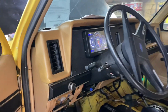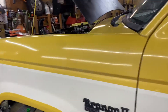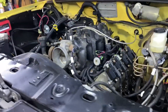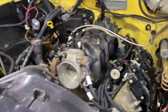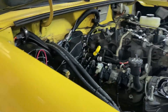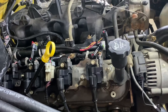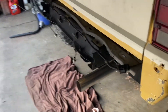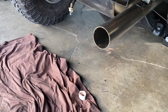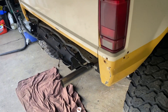She is now fully warmed up at idle and sounds nice and smooth. Got the heat — it is blasting heat in here. There she's idling steady. Water temp just under 200 degrees, oil pressure 30 pounds hot. AFR is high 13s. I like it. I like it a lot. Heck yeah! We're good — air pockets are gone, cooling system is circulating. Heater hoses are nice and hot. She's good. That is just so tame, nice and quiet. I like it.